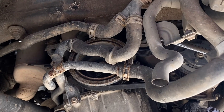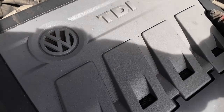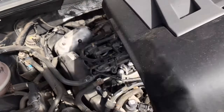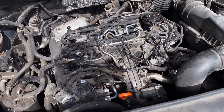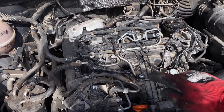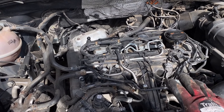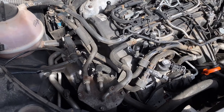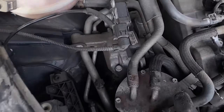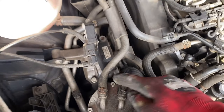Back under the bonnet — let's get the engine cover off, it just pops up at the corners. The Skodas have an inlet manifold/charge cooler that looks a bit like an intercooler with pipes — the engine setup is the same so if yours looks slightly different, it's all good. First thing I want to do is get the fuel filter housing out of the way, so I'm going to undo the three 10mm bolts — one there, one there, and one hiding down there with a long extension bar.